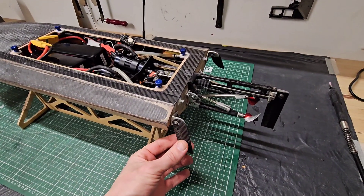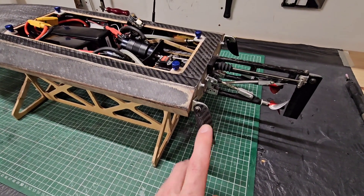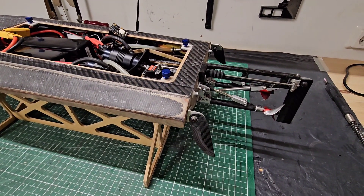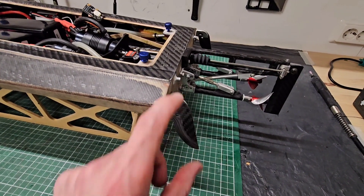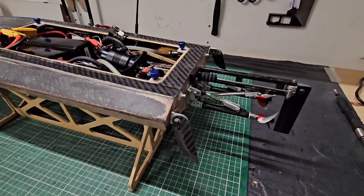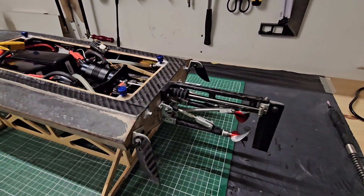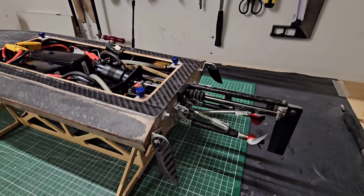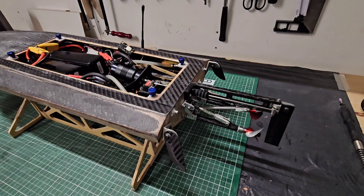Unfortunately today I couldn't really try the long turn fins — I ran them for maybe one minute. The first impression is very good; the cornering definitely improved. I could notice that the straight-away top speed was reduced, which really shows that running long turn fins, which always stick into the water, will definitely increase the drag of your boat. I'll definitely test them more. Next time I'll run them together with the golden props — those are 43 1.6, while these are 44 1.9. So the golden props should give a little bit more punch and I think it's better for overrunning. Hope to see you guys next time — bye!